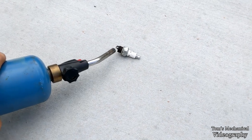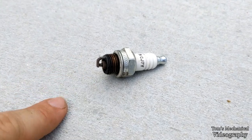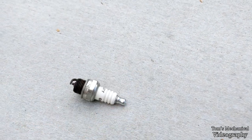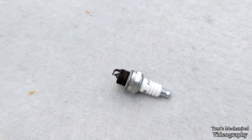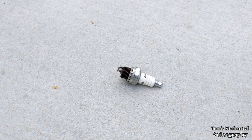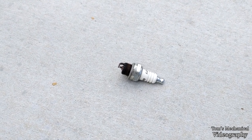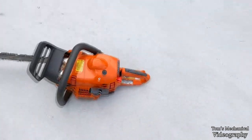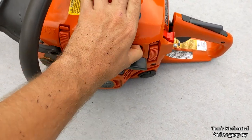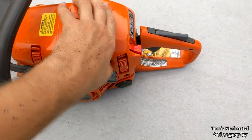We're gonna blast this guy with a propane torch and see if we can get rid of some of this carbon. That's working real good. She wasn't even that fouled — looks a lot better now. We'll let that air cool for a minute. I have a hunch that it was not a fouled spark plug causing the problem — I have a feeling it might be the CDI pack. But we'll throw it back in and let her heat up and see if she refuses to start again. She's back together. I'm going to try to get this thing to run cold. The primer bulb isn't filling up all the way, so that's something I might need to pay attention to — may actually be the fuel filter.